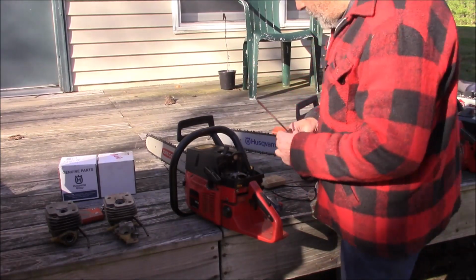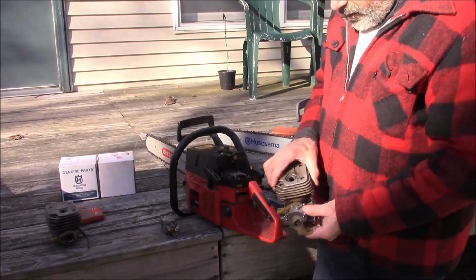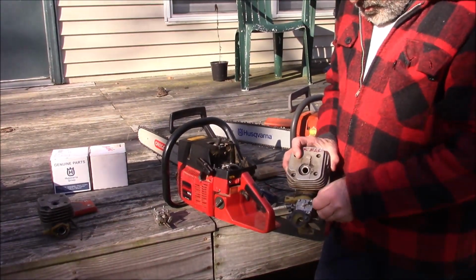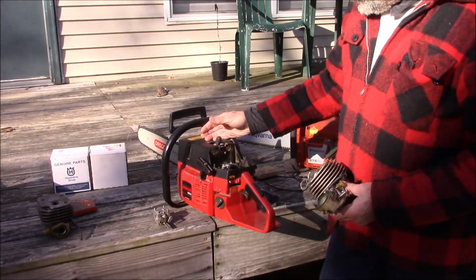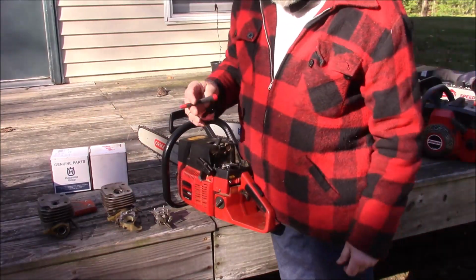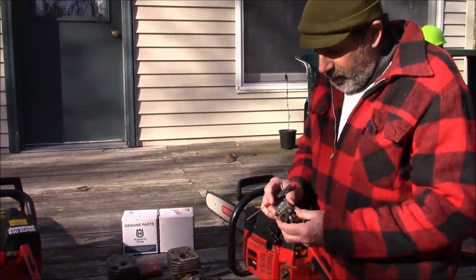The carbs is what gets tricky, because there's two different ways to pulse the carburetors. Now the 625 or the 670 has this pulse line coming out of the side of the cylinder, right? Everybody's familiar with that. It goes to the top of the carburetor. That's how you pulse the carburetor with these. So if you want to switch to the Husky top end, it's going to be pulsed through the block. Well, all these HS Tillotson carburetors are pulsed one or two ways. It's either with this external line, or it's through the intake block, and they're all pulsed the same place.